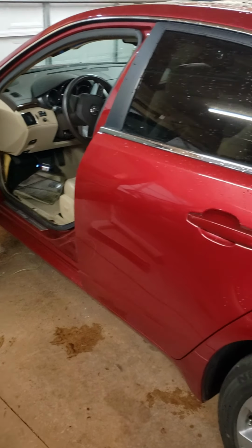So basically what I did was I jacked the car up and pulled the tire off, pulled all the screws out, dropped this side of the inner fender well. And yes, you could see where the nipple was poking out from the drain tube. So in his video, what he said was he unhooked the hose from the nipple and ran a piece of string all the way up, and he did find debris somewhere in between, and it fixed his issue. So I did the same thing.